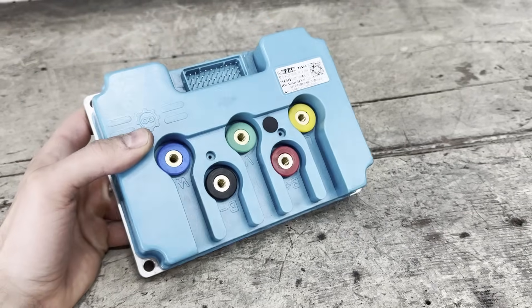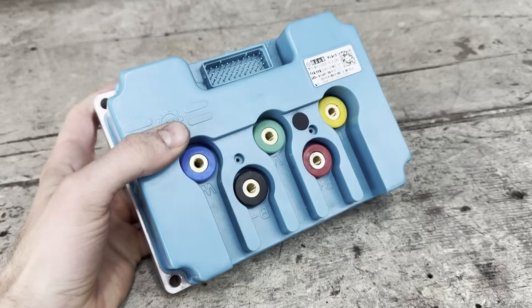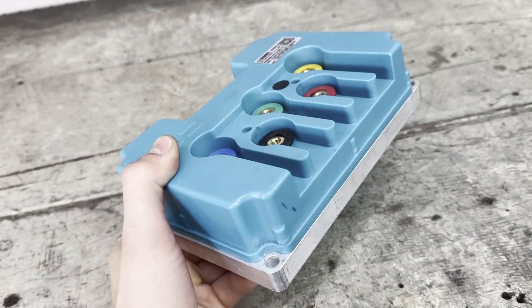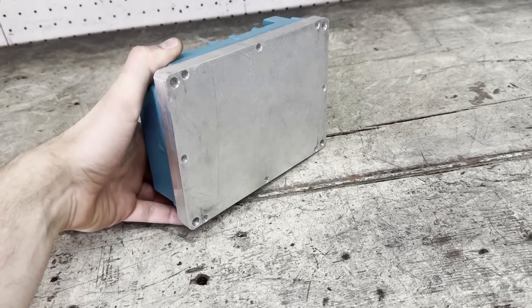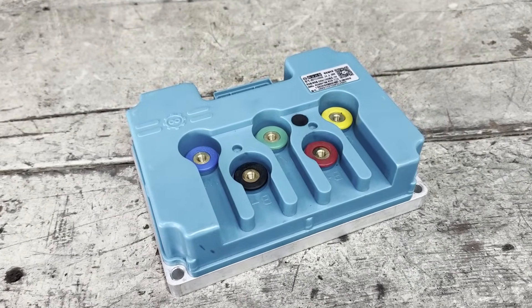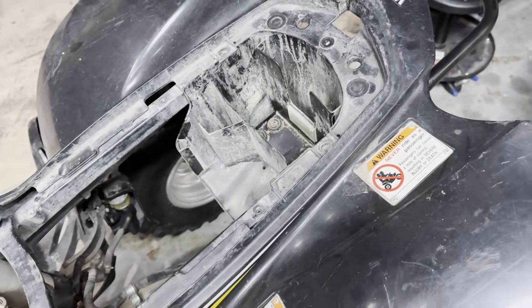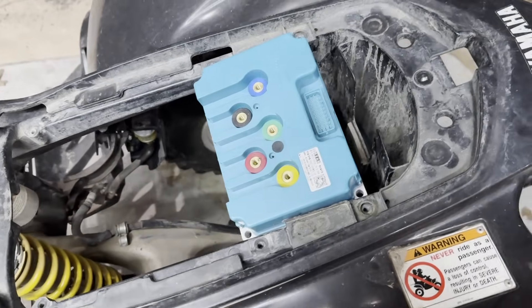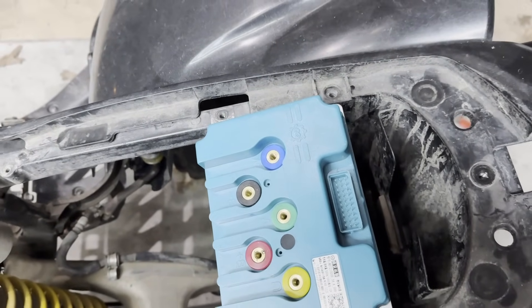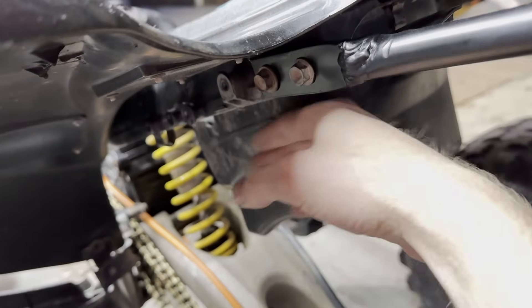Now it's time to look at the controller. This is a FarDriver ND721000B, which means it's for 72-volt batteries, it can do 500 battery amps, 1,000 motor amps, and it's for encoder motors, not hall effect sensor motors. It doesn't have a very good heatsink, so it may overheat, but we'll see. If I put the plastic back on the quad frame, you can see the battery used to be mounted all the way back here, so I think I'm going to mount the controller back there to try and keep the weight distribution the same. That's a super convenient fit. One thing I need to do is cut all this plastic off the bottom so the controller can get some good airflow.